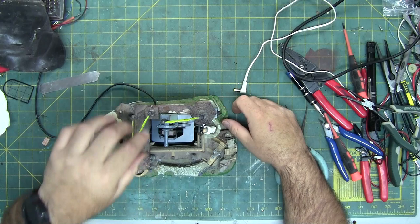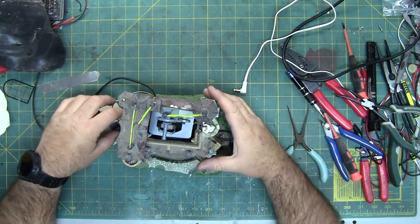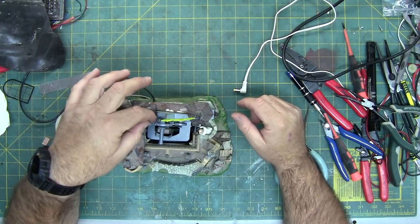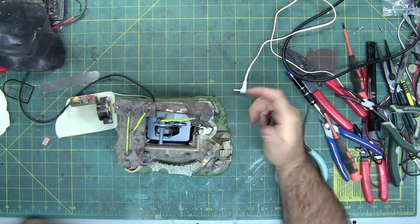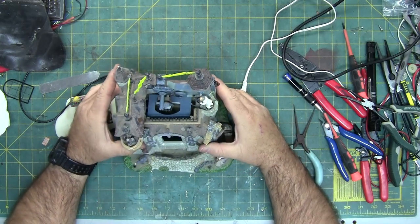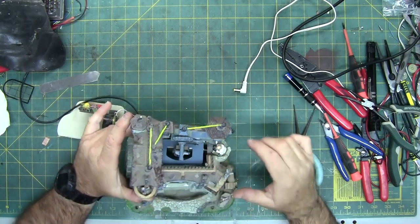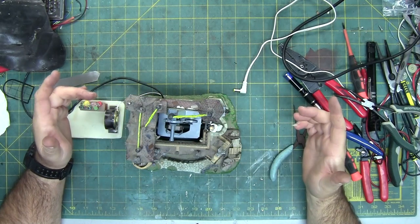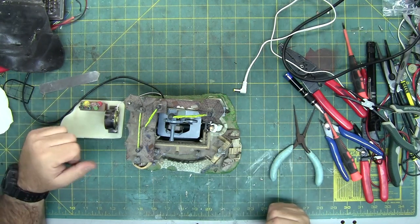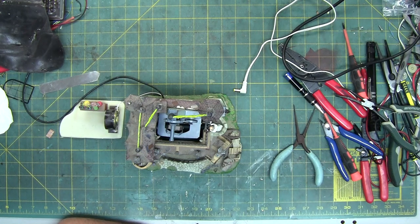Lift the whole piece out. If you need to get to the gearbox — all those gears inside — you're going to have to pop this cap off to remove that screw so you can get this back piece off. Then all the other screws are accessible, might be covered in glue, just pop the glue off. Replace the gear with appropriate gear kits — they probably have all of them since this piece is old enough that they weren't proprietary yet. If your motor is bad, get a short pigtail motor, cut the red and black wire close to where the motor is, and replace it. If your belt broke, you can replace the belt from the bottom without doing much more than taking the bottom off.